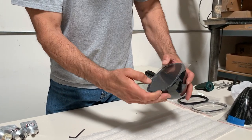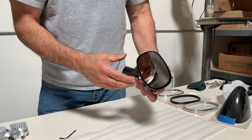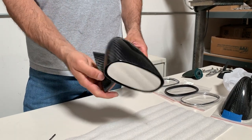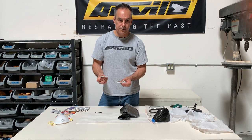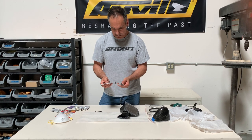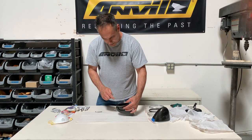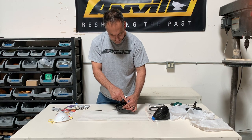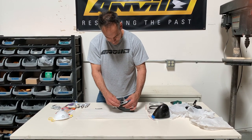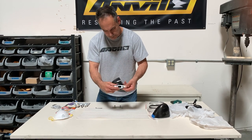It's pretty resilient and strong stuff so it should be okay. Now that's together and you can adjust accordingly. I like to leave the protective plastic on while mounting the mirror to the car so nothing gets scratched. Next I want to talk about how to put our mounting brackets in the stem — we get a lot of questions about that because it's not necessarily apparent. There is a left and right — these are mirror images of each other. You'll notice the bottom of the stem is a little flatter on one side and rounder on the other, a little bigger here and narrower there — pick the right bracket that matches.